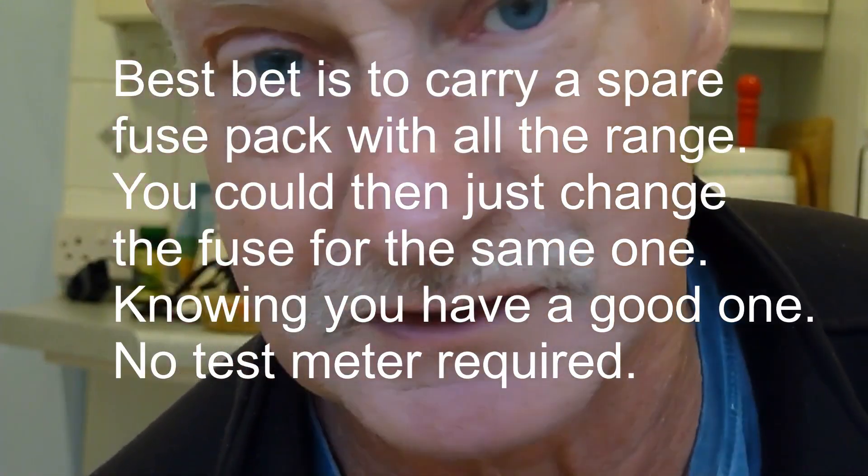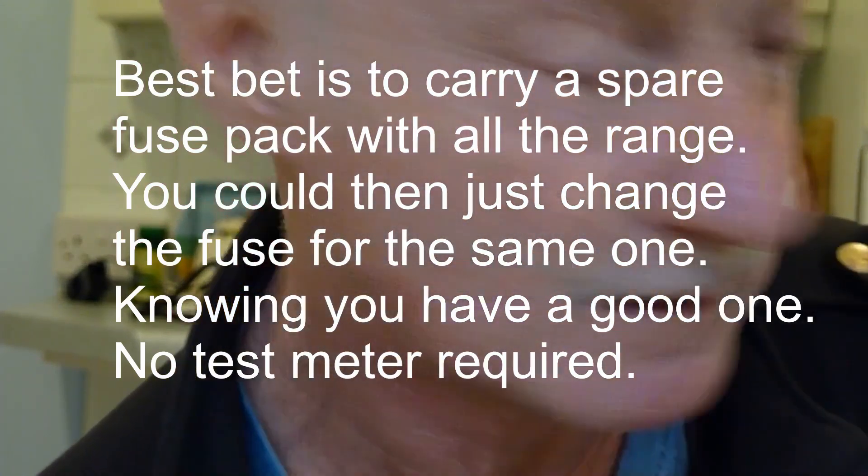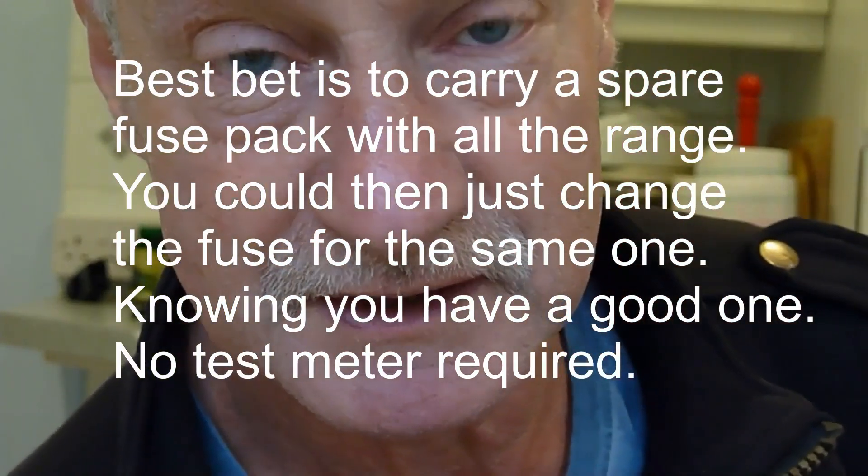The other easy way of checking a fuse if you haven't got a test meter is just to take the fuse out of the appliance and try it in something else to see if it works. Make sure it's rated the same as the fuse in the appliance you're testing. Like this is a 3 amp — don't try it in something that's 13 amp. Make sure the power rating is the same before you test it, otherwise you'll just blow the fuse. If it was a standard lamp, this 3 amp fuse would work in a 3 amp standard lamp. If you're doing a kettle fuse, that's 13 amp — try that fuse in something else that's 13 amp. Other than that, it's a fairly simple and straightforward job checking a plug fuse.